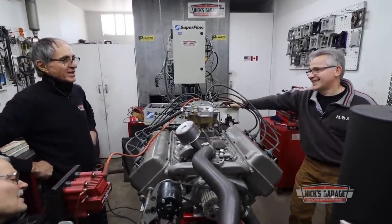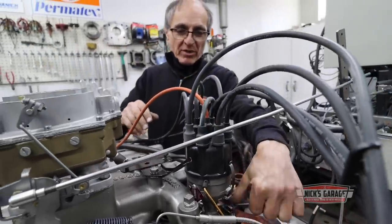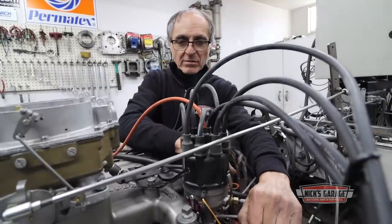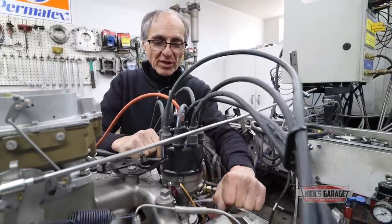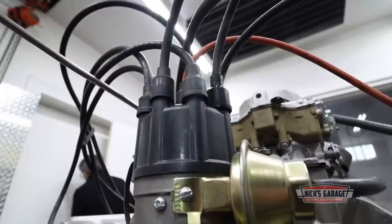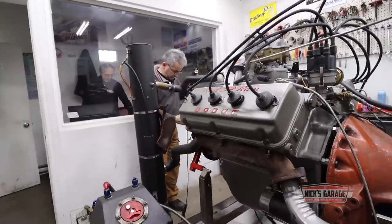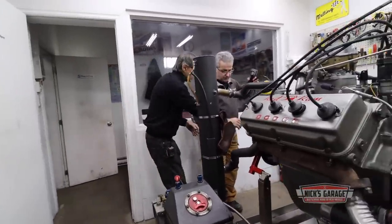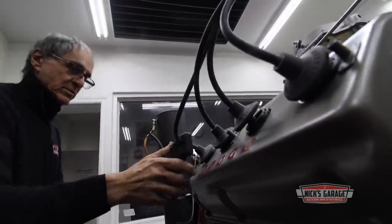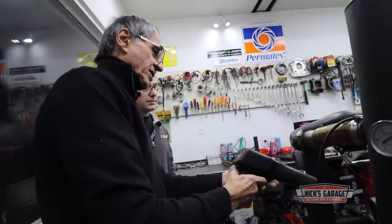Did you hear it pinging when I gave it 33 degrees? Maybe I should give it more. I'm gonna advance it 2 degrees. Maybe the distributor turned. That was about 2 degrees, but you know what? Let me put my timing light on it. There you go, 680 RPM. What a rumble. There it is, man.